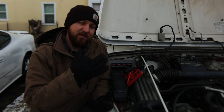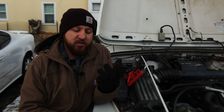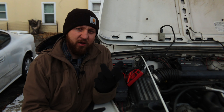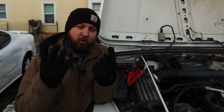So what we've done so far: we've done a ground test and verified that there's no weird voltage feeding back through the system. The reason that matters is that on the TJ computers — and probably most computers with the regulator inside them — a voltage issue through the ground can trick the computer into thinking the battery is full and doesn't need to charge. So a bad ground could be step one of your charging issue. We tested the grounds and they're in good shape. We took the alternator to AutoZone and tested it in and out of the Jeep — it passed. The battery is brand new, only a week and a half old, and AutoZone tested it — that's fine too.